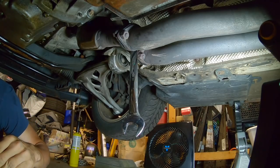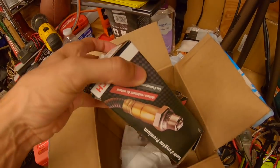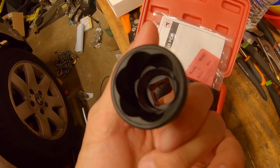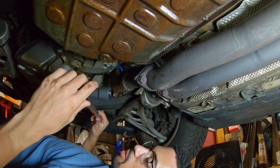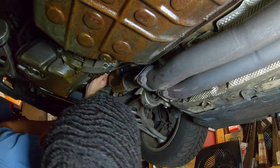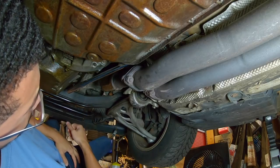I just finished door dashing at 8:30 — part five — exhausted, but I got these twist sockets in the mail today, 22mm, which is exactly what I need, along with the replacement O2 sensors I re-ordered. These twist sockets should chew into the head of the stripped sensor and hopefully get it out. I'm testing whether the half-inch breaker bar fits in a position where I can actually pull down on it — I have plenty of space, and it's gripping tight without even needing to tap it on.